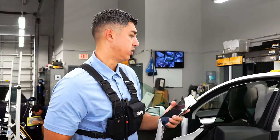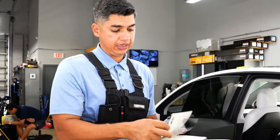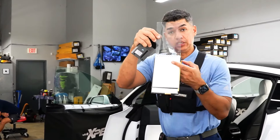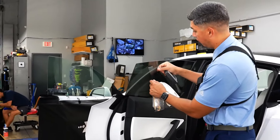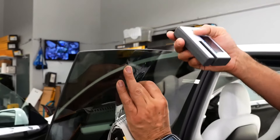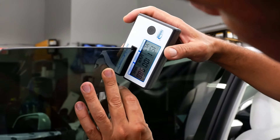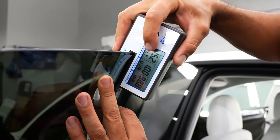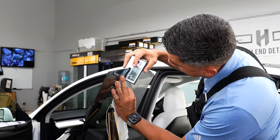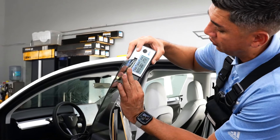What we'll do is put a light film — the 70 percent — on the back, since she does want the whole car tinted. We'll use XR Plus 70 percent on the black glass. With the tint meter on top you can see that the XR Plus brings it exactly to 15, and the infrared reading is at 98.8 — so that's a lot of heat being reduced with this film.